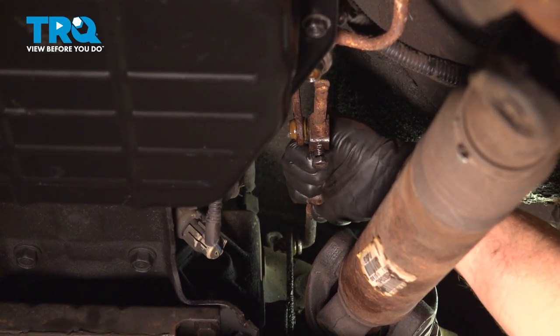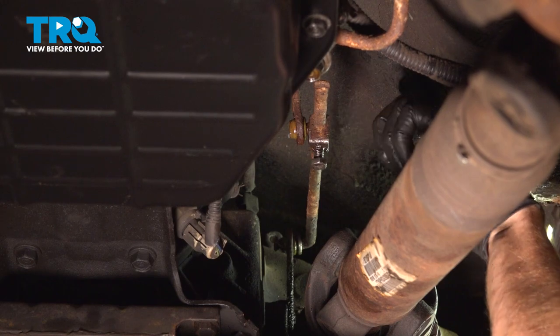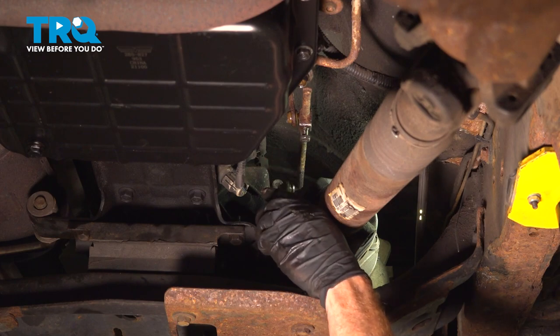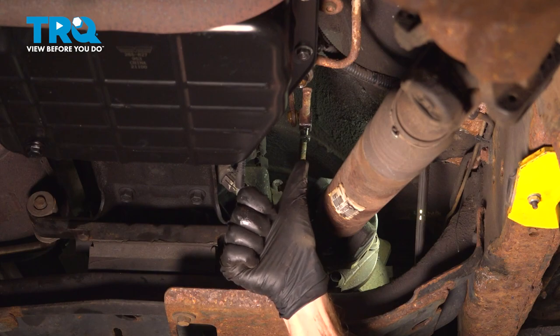Once you feel as though you have it properly installed, take hold of it and try to pull it out of those bushings. If it falls right out, you didn't install it properly. This feels fine. All right, friends, we've got the truck back together. At this point, go ahead and make your way out from under here and test the four-wheel drive. Aside from that, thanks for watching.